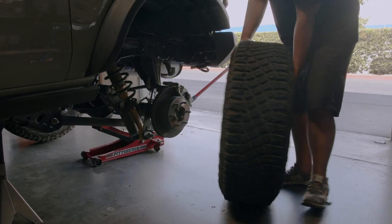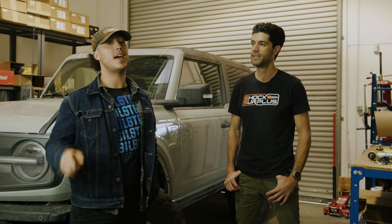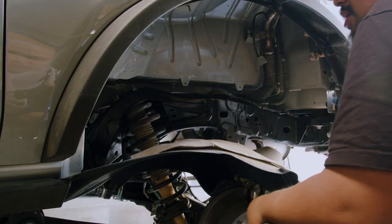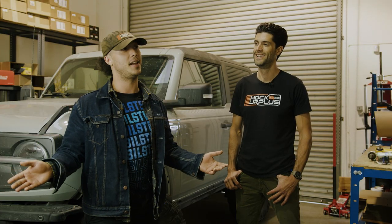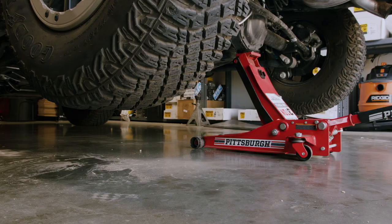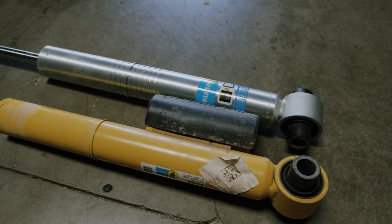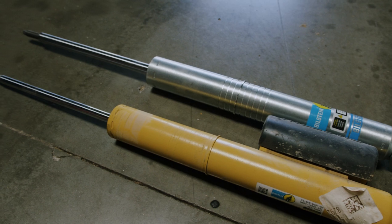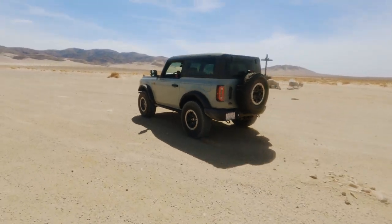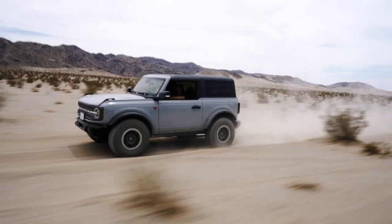We weren't on 37s during the 5100 testing — those came on after — and I don't think you should even try to put 37s on the 5100. I basically smoked a couple tabs and tore my fender liners with stock 35s, not because Bilstein didn't do their testing, but I just hit the bump stop so hard it bottomed further than intended. With a 37, it's not going to clear and there's just not enough damping force for that tire. For most people just cruising on the trail, get the 5100s — you'll be happy being able to go 10–25 mph down the trail instead of being stuck at 5 or having to smash it.